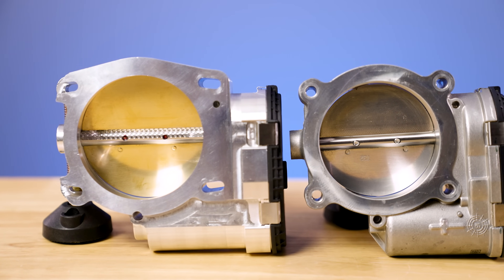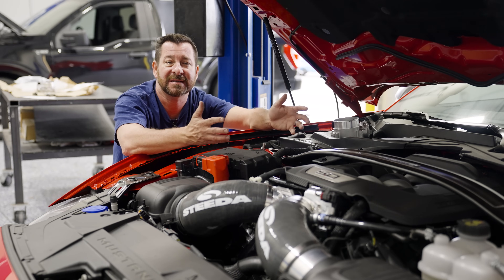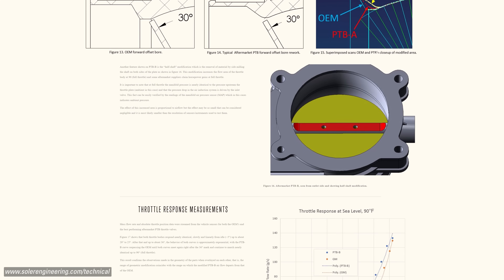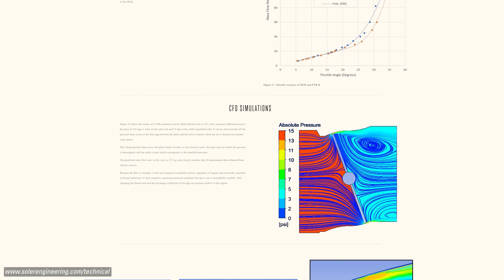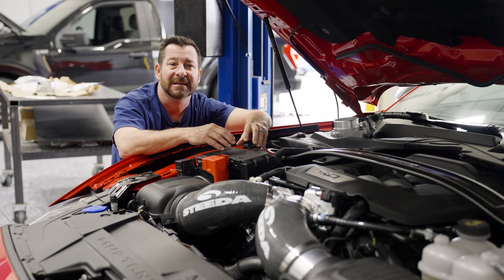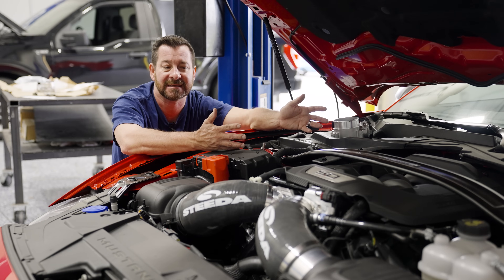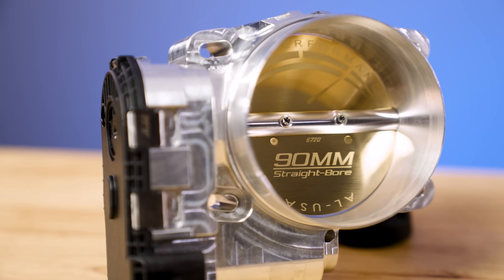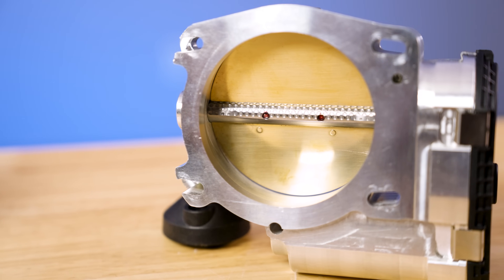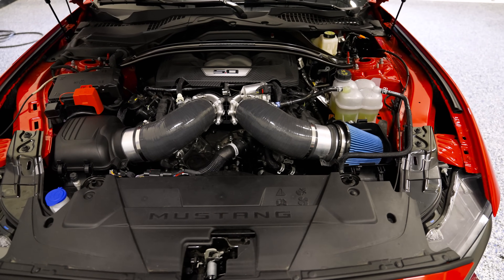Why do you need all that extra airflow? You've got two air boxes, two intakes. The theory behind it is not only increasing airflow but streamlining it. If you go to the Solar Performance technical page you can geek out over all the little things they did to help increase and smooth airflow. Less turbulence means more potential for horsepower because you increase velocity. Speaking of that, it's a true velocity throttle body — it tapers down, has really smooth radii, and runs a number 16 micro-inch finish, which is unbelievably smooth. It should pair up really well with the Steeda velocity cold air intake system.